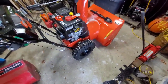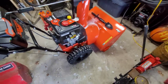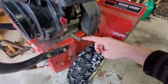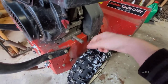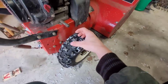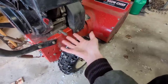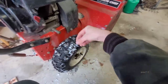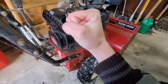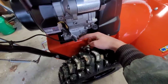I think it'll be a good machine overall. One thing I'll also have to do — the guy told me it does not come with this part. See this little piece of pipe? So you can do an oil change yourself: you unscrew this and put a pan underneath. Usually you remove the tire — it's just one pin — put a pan under it. Or if you're like me, I just put a cheap pie tin under here, shape it, then use a pot to collect it and prop the other wheel up on a brick with the machine slightly crooked.